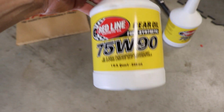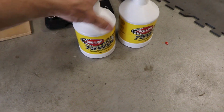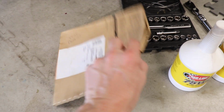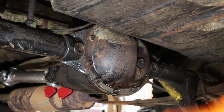And this can all be done with just simple common hand tools. And we've got our gear oil here. This is obviously Redline 75W90 GL5. This was actually given to me by Redline for this fluid change, but I'll link all this stuff down in the description below. And a nice Felpro Dana 35 differential cover gasket. This is our fill plug right here on the Dana 35.